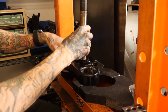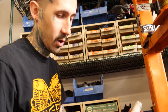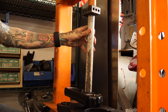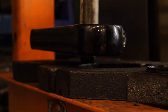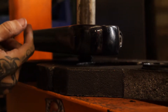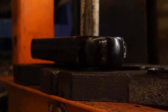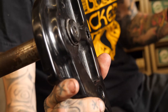We're going to want to put something underneath to support it. Now that special tool we spoke of earlier is going to get used. The snap ring at the bottom of your stem is going to act as a stop, but you don't want to overdo it — you just want it to barely touch. There we are, stem is in.